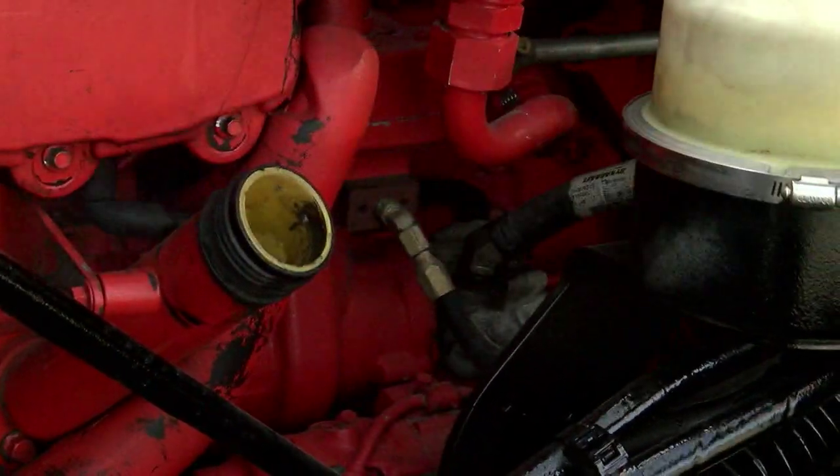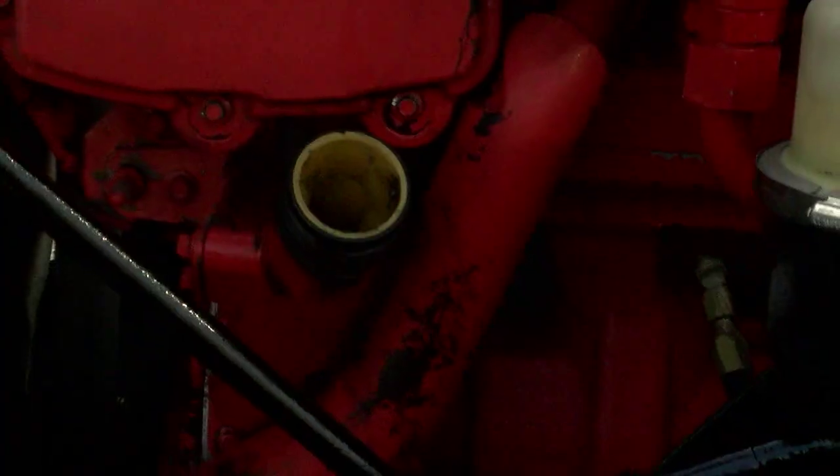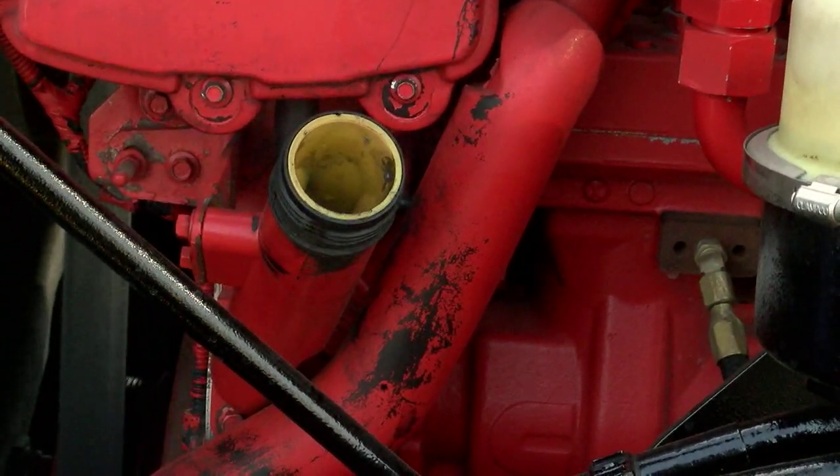The most important part of our inspection of an engine is checking the blow-by. We came back from our road test, got the engine warm, and now we want to check the blow-by. Most engines are going to have some blow-by, but you don't want it spitting oil at you or puffing like a freight train. And that's how you inspect a diesel engine. If I missed something, please feel free to comment below. If you want to see more how-to videos, please subscribe to our YouTube channel.